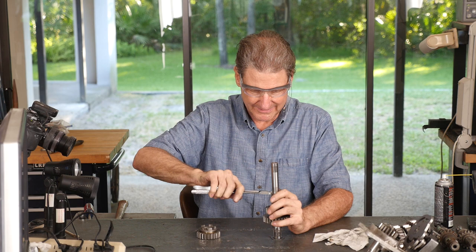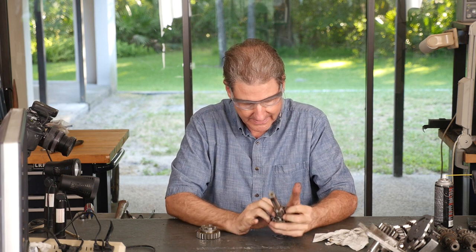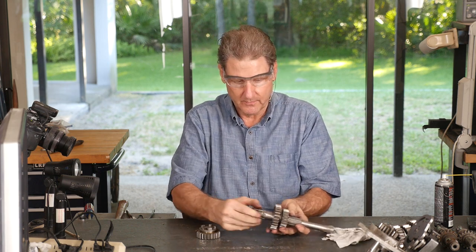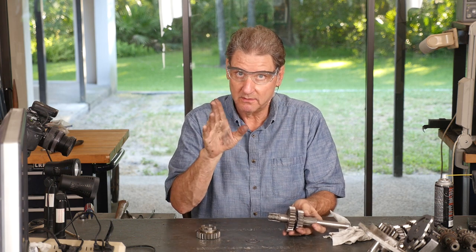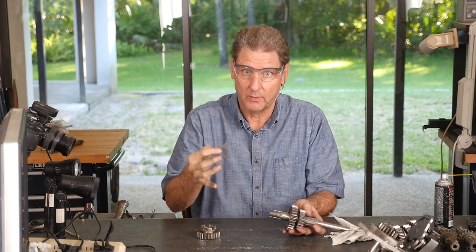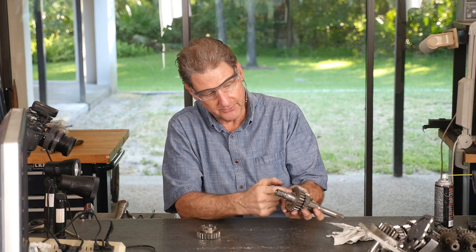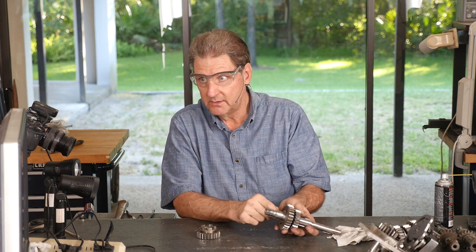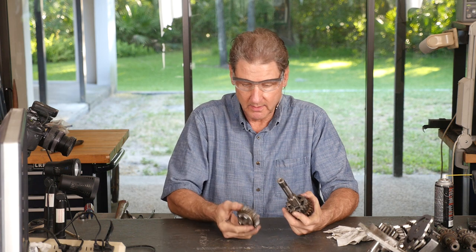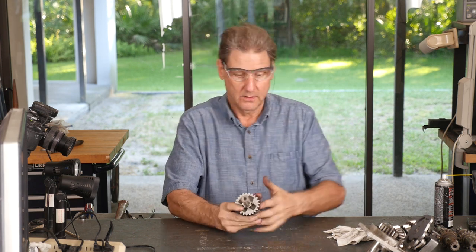There's this thing that shoulders up - obviously the females go here to engage. They don't let this surface run against the sharp corners of the spline, so there's one of those washers with two little indentations that you rotate and it slides up, giving a nice non-rotating steel surface. Then there's a snap ring - they say to replace it every time. I like to use piston ring expanders; it goes in like that, expand, then slide, slide, snap. Make sure it's seated nice.